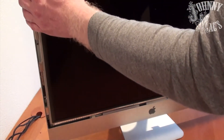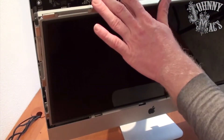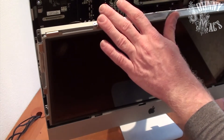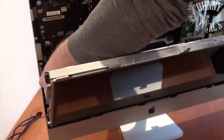After the side display screws have been removed from the LCD and the system memory has been removed from the bottom of the machine, care must be taken to disconnect the four cables connecting the LCD to the various components on the inside of the case. Damage to those cables or the sockets on the board can be very costly, so please take care.